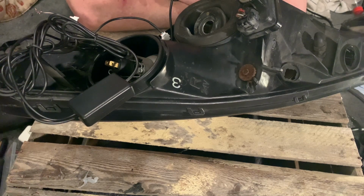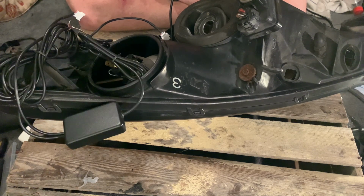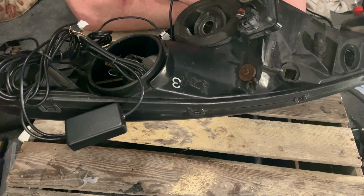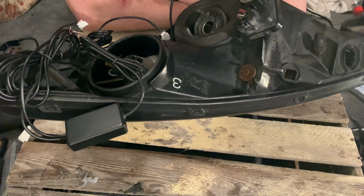One of the options is to wire them directly into your front fog lights. So, you know, if you're at a show or, you know, you're parked up and you want to use them, it's a case you can just switch them on from the inside on your dashboard and pop your fog lights on and your demon eyes will come on without your headlights coming on itself.